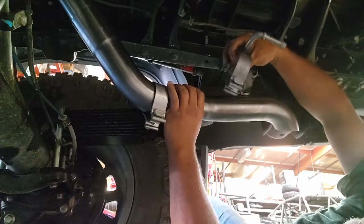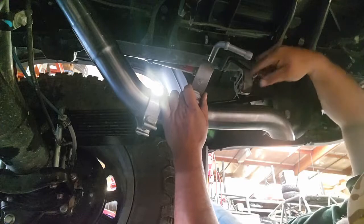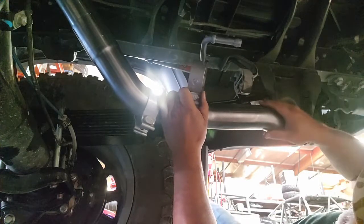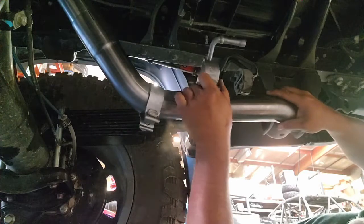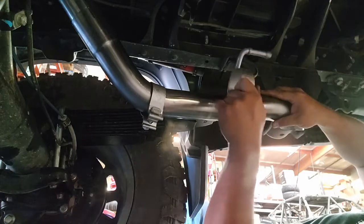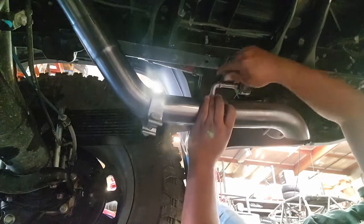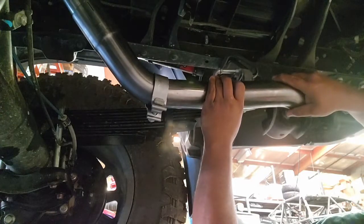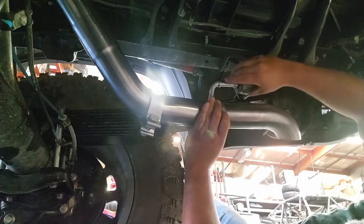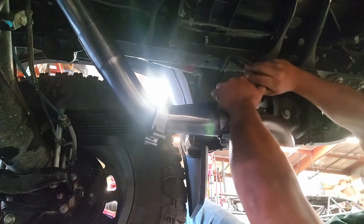And the reason why we've left this separate and not welded to the pipe like we have traditionally is it gives you some degree of adjustment. There's a lot of different suspension configurations available out there. And with different gear going in, we wanted to make sure that you can get the height exactly where you wanted. So once you slip this over, your position that you put it into can move this further away or closer to, based upon what space and availability you have. Being that this one's fairly stock, it's going to pretty much go in the straight up position.